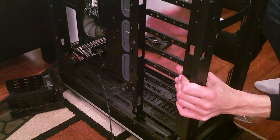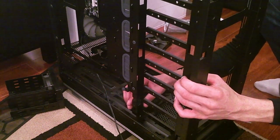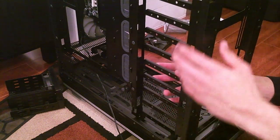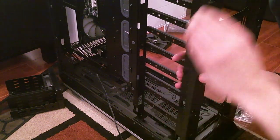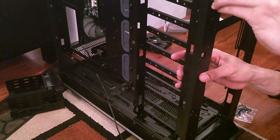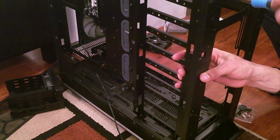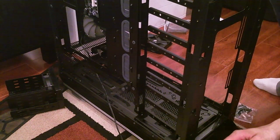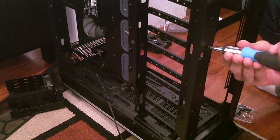I have a little less GPU clearance, but I checked and the graphics card doesn't extend that far, so it's really only a benefit. We'll realign and remount this. I just can't wait to have the case assembled — even just having the fans in will feel like a big accomplishment. Usually it's just take the case out of the box and throw the parts in, but when you can invert everything about 20 different ways, you start asking: what's the best airflow?